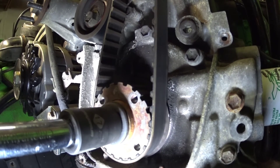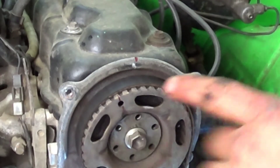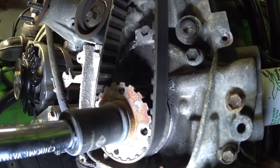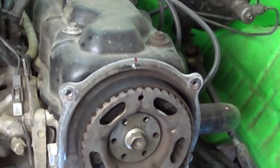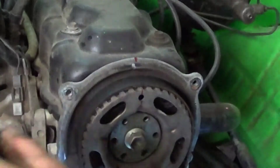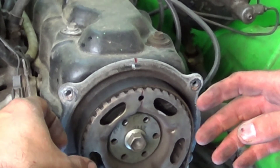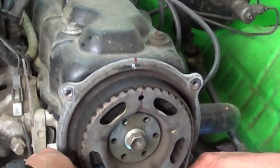Okay, here we're coming up on the line. We can see our line coming up to the mark here, and our dot is coming up to line up there. Bring it — bang on. Looks like it's bang on. So we'll leave it like that. The reason you do that is: when you take this belt off, if anything turns, you have reference marks where to line stuff back up again. It really shouldn't turn.